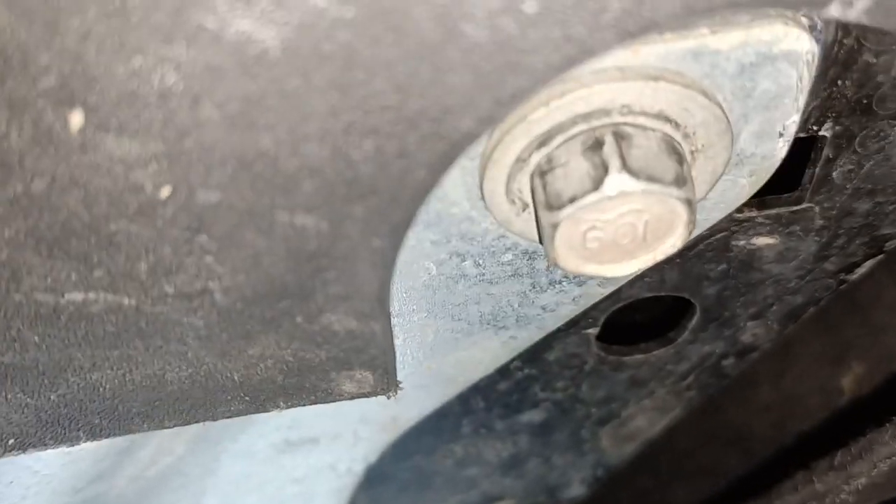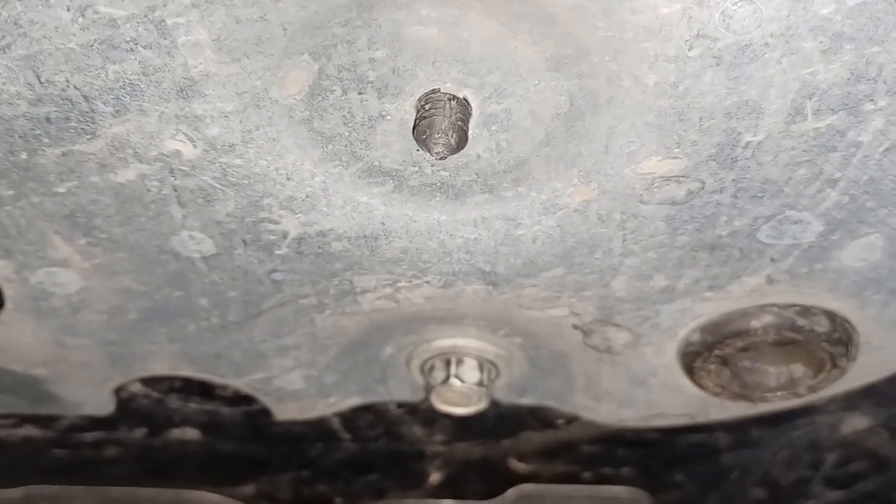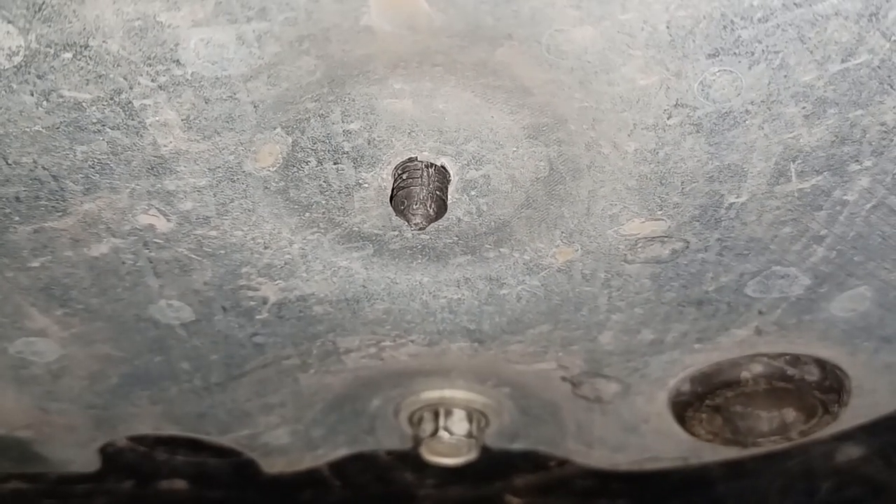There are just four of those going across the front, and then there are six bolts that are 13 millimeter head. You've got one on each side, the other side is exactly the same, and then in the back there are two that you just loosen up because the plate is slotted — those kind of serve as alignment pins.